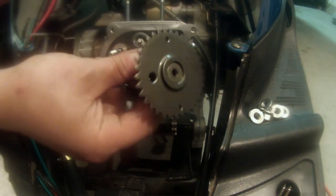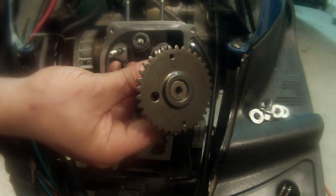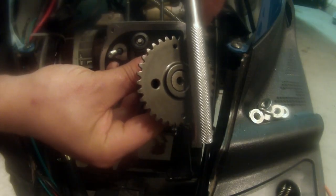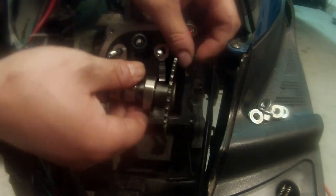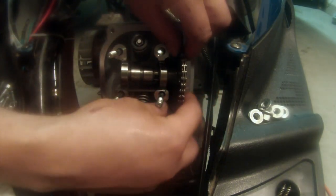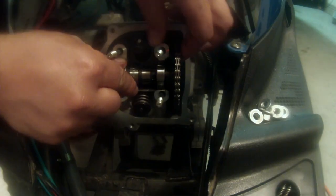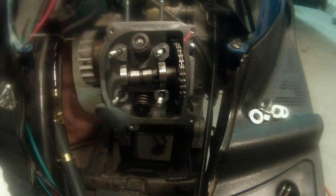Now this is important, and take your time on this. We want to make sure that those holes line up, as we talked about before. If this ratchet was the side of that cylinder head, that's how we want it lined up — let those two dots line up like so. We need to put it in that exact position. I don't think I can emphasize that enough. If you do a big bore kit and it doesn't start, this might be the first thing you check. I think I got lucky and nailed it on the first try, so I'm just going to pretend like I do that every time.